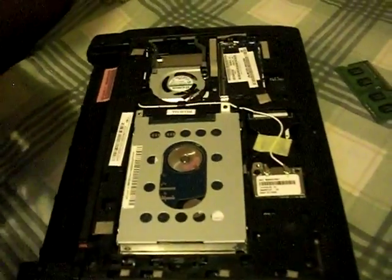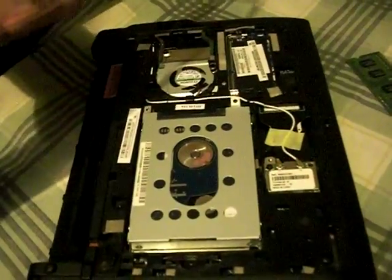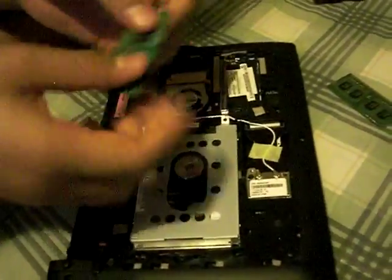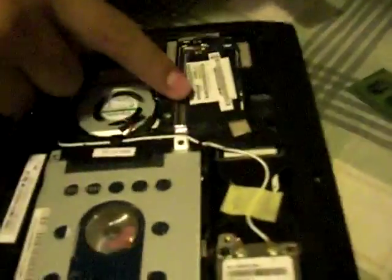Be careful, don't pull too hard or you'll break it. The small notches on the RAM go toward this side — you can see it's separated by a notch, small on one side and larger on the other. Line it up and put it in like this.